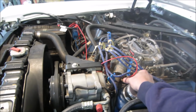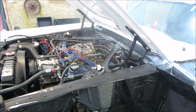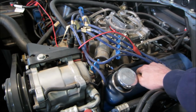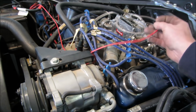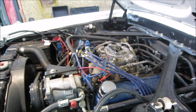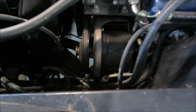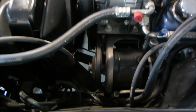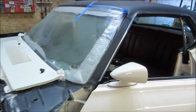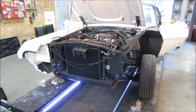I'll let it cool down a little bit, make sure everything's doing okay. I think you just burn all the crap off that's coming off around the engine from old seeps and leaks and new paint. Everything's still cold. Valve covers got a little bit of heat in the valve covers. Let it run. A little wobble on the power steering pump. I looked to see if it had oil pressure, if I had gauges. Well, we might as well go see what the underside looks like.